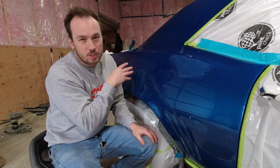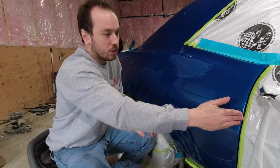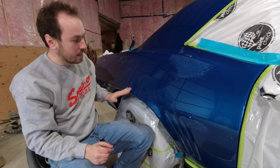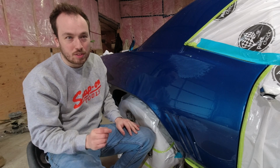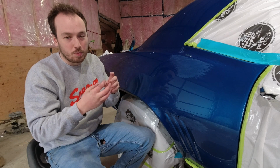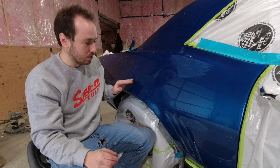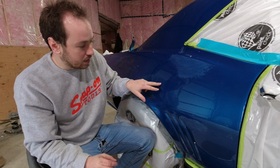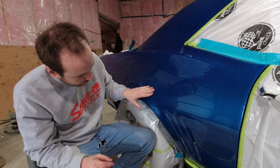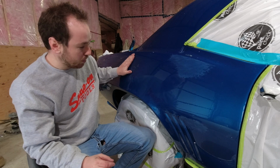So I was working on getting it filled, looked like it was gonna fill, and then I pushed this door shut, and then on the next coat I sprayed, I had fish eyes from one side just about to the other side. So I added the silicone additive to the clear, which is a way to make the clear bind to any kind of contaminants on the surface rather than separate down. Then I started dumping the clear onto it to get these little holes filled up and give me enough material to polish out. I think I got enough on there. In doing that, that's how I got the runs, was really pouring that clear on to fill up those pinholes or fish eyes.